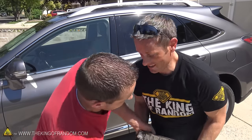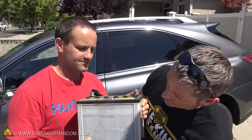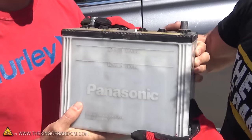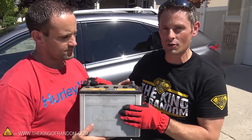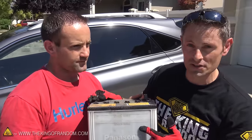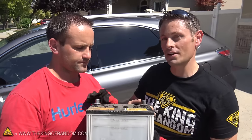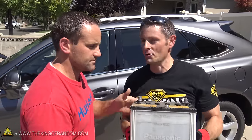Dude, this thing's really heavy. These batteries are like 40 to 50 pounds — super, super heavy. And you can see there's a liquid in here; if you shake it, it'll slosh around. You can actually even see the liquid moving. This is called a wet cell battery. There are types of batteries called non-spillable that have an absorbent glass mat on the inside that soaks up the sulfuric acid and keeps it from spilling. But what we're after is this stuff — a mixture of about 25 to 30% sulfuric acid, and the rest is water. We're after that sulfuric acid and the lead plates inside, so let's go crack this thing open.